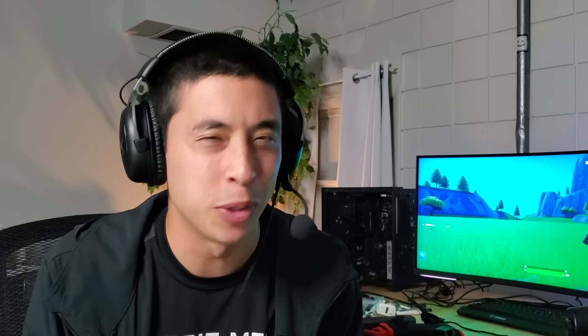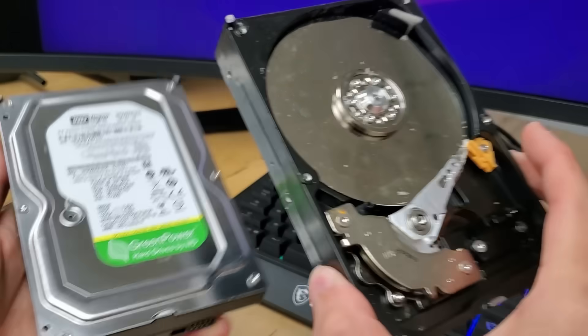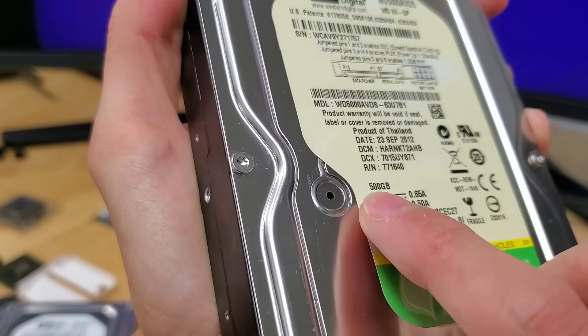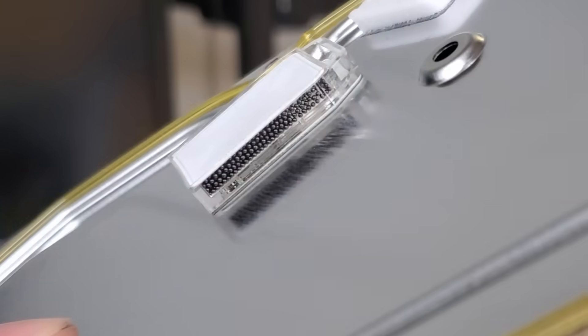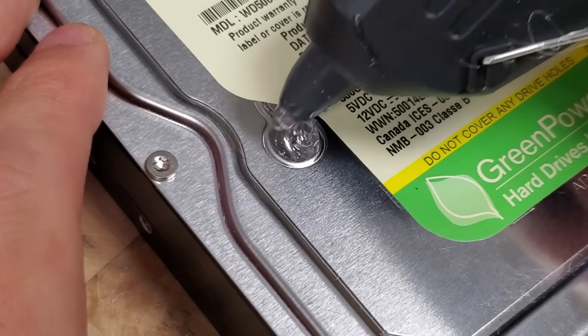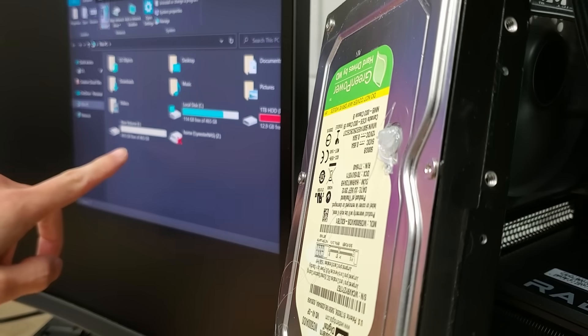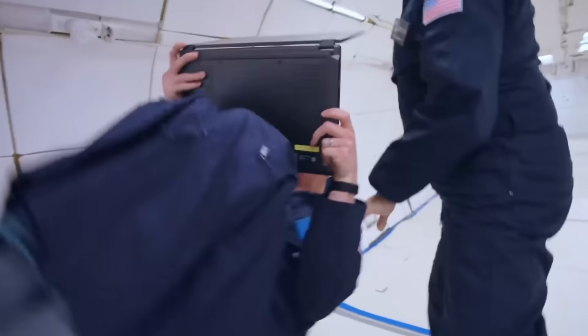Cover the holes with glue. What are those holes even used for? Hard drives require a very specific internal pressure to keep the magnetic arm the right distance away from the discs, and these little holes help maintain that internal pressure. Fun fact: on the underside, they're actually connected to a tiny little filter. Since they say not to cover up these holes, let's do just that. Some hot glue will fully seal off the breathing hole. Surprisingly, nothing seems too off — things continue to work completely as normal. Since we covered the holes at the same local pressure inside my studio, nothing changed internally. Realistically, we probably wouldn't notice any issues unless we drastically changed our altitude. Covering the hole: 2 out of 10 effectiveness if you're staying local.